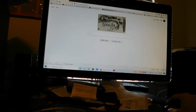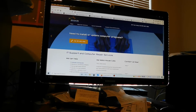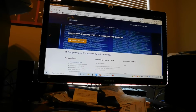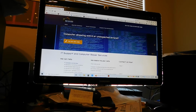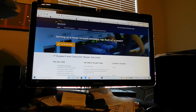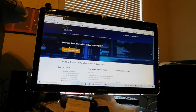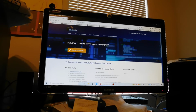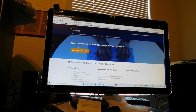So that's pretty much the ins and outs of it. Once you install the solid state drive, you're going to use your Windows installation media, which is like a USB drive that you download the Windows installation media on. I have a video as to how to make one of those. I'll link to that in the description. You plug that in, you boot to it, and it should install the operating system on your new solid state drive in about 10 minutes, depending on what processor and how much memory you've got. It doesn't take very long. And then you're rocking and rolling.